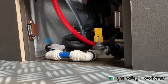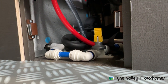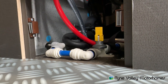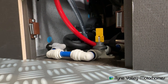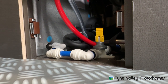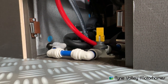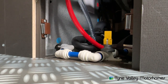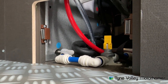You need to have your fresh and waste valves open. You need to have all your taps within the van left open. You need to remove your shower head from the hose and lie the hose in your shower tray with that tap open — just to eliminate any water that's sitting in any taps, any pipes, any tanks, so that the vehicle is free of water. Then turn the pump on for 10 seconds to blast the pump out, because the pump has a filter that holds water. Then the pump off, and this vehicle is drained down for the winter.